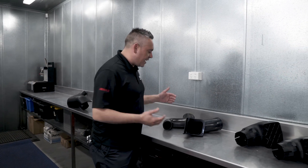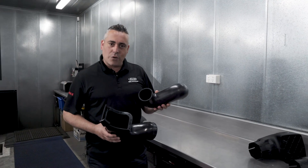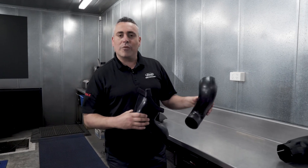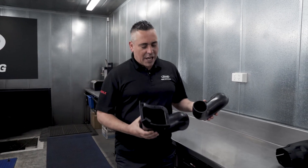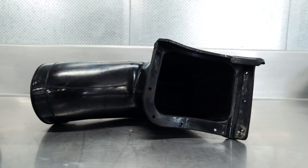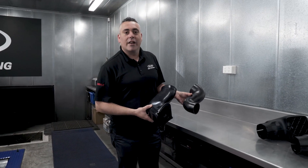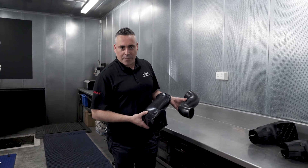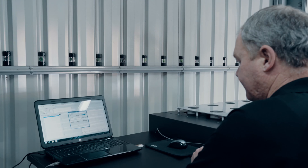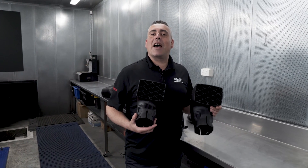There are a few other aspects of the RMAX snorkel you may not easily see visually. Comparing the two hoses: the V-spec snorkel hose has a discharge port from the snorkel body that attaches to the air cleaner element. Side by side, the air entry to the airbox on the RMAX is much much larger — the airflow is smoothed out and seamless going into the airbox. Safari spent a lot of time on their airflow test bench developing the airflow into the engine on the RMAX snorkel.